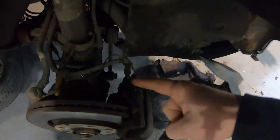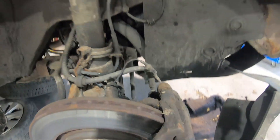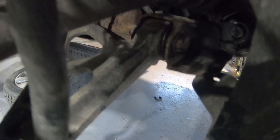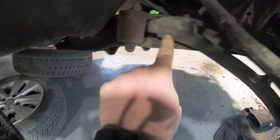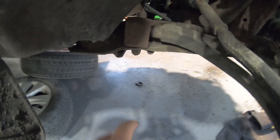The only other things I have left to do are a split CV boot and an inner suspension arm bush - hopefully you can see it's got a bit of play in it. I've got a new bush and a new CV boot. The problem with this suspension design is that the bracket for the suspension is bolted down and you can't lift it up because the chassis is in the way, so the subframe has got to come out.